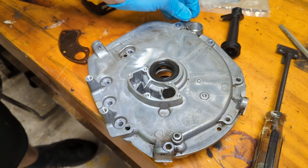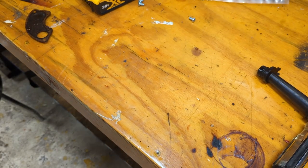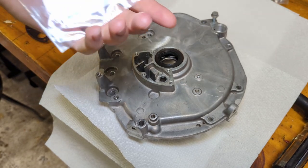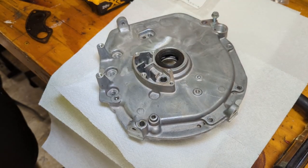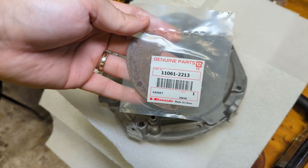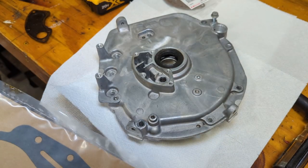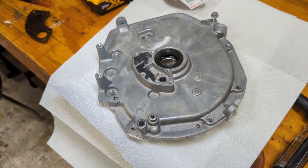Take this sump over to the parts cleaner and just give it a good washing. Okay, I got the cover all nice and cleaned up. Lay down some clean paper towels. So now we have our dipstick tube O-ring, thanks to the folks at Parts Tree, not a sponsor. Have our breather gasket, and our sump gasket. But again, if I was doing this job again, just because I'm in here anyway, I would have done a crank seal, but I didn't, so I'm not going to.